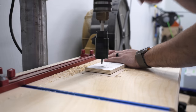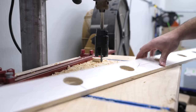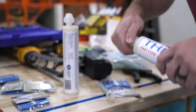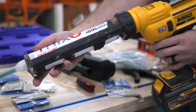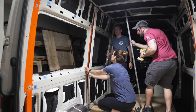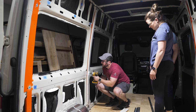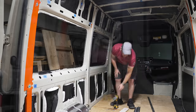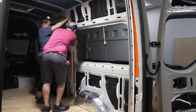Once the holes were drilled, we could get the furring strips mounted. To mount them throughout the van, we used a combination of self-tapping screws and Thixo epoxy adhesive from Total Boat. This stuff is insanely strong and easy to apply with a caulk gun, although I'd definitely recommend an electric caulk gun since it's pretty hard to squeeze out by hand through the mixing tip. I got a bead of Thixo applied to the back of the first furring strip and then mounted it to the wall bracer, using the L-Track to clamp it in place. The L-Track mounts to the threaded holes in the rivet nuts, and I started in the center and worked my way out since the L-Track needs to bend to conform to the curvature of the van walls. We repeated the process on the rest of the wall bracers.